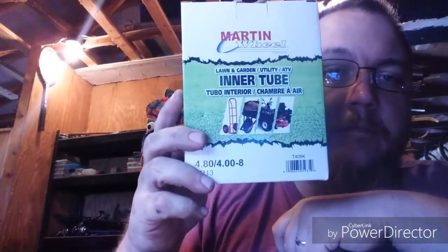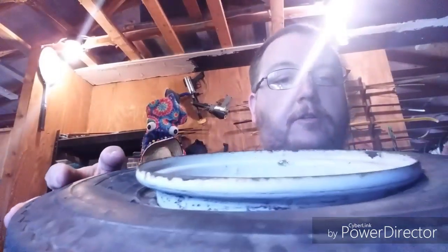So I had to get creative. What I'm going to try is to convert this, which was a tubeless tire, into one that takes a tube. So I did find the tube. I've already taken the liberty of getting it off of the bead — basically me sitting it on the floor and standing on it until it popped loose. Then I took a pair of pliers and pried out the valve stem.